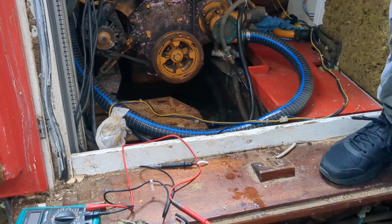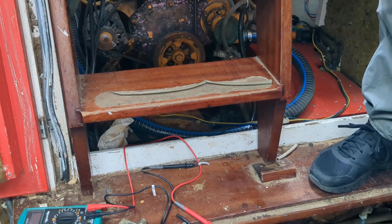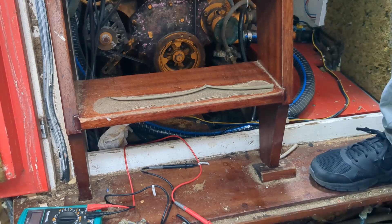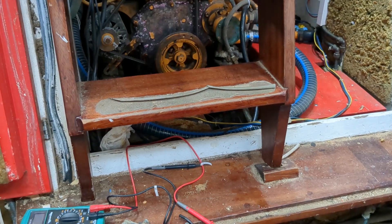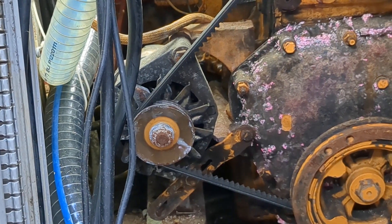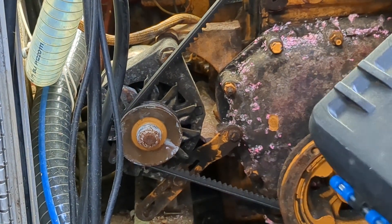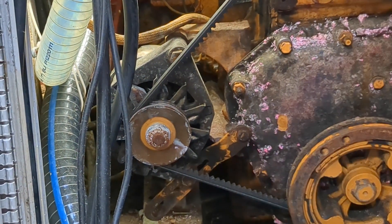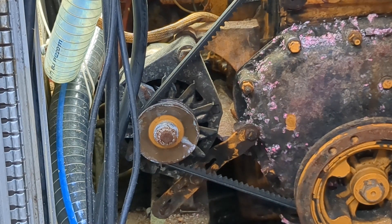We talked a bit back and forth, and I described the power draw I was seeing, and he agreed that something was off but wasn't entirely sure what. When all the switches are off, the power draw should be somewhere between very low and none, as there should be no path for the current except possibly through a few relays. But I still saw some sparking when I connected the battery terminals, so something was definitely drawing more than a little bit of power. Seeing that I've disconnected and physically removed all of Ophelia's electrical systems, the only source of this parasitic draw is either a short somewhere or something on the engine itself.